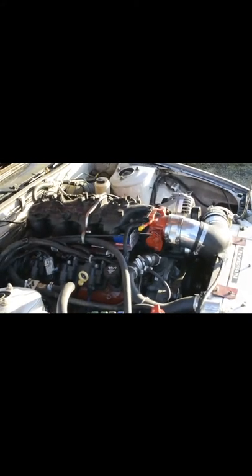There weren't many clearancing issues besides the obvious hood. I had to modify the crossmember a little bit — as in remove about a half inch of material just to fit the oil pan. I had to make a bracket for my front sway bar and then bash the trans tunnel a little bit in order to fit the T56.